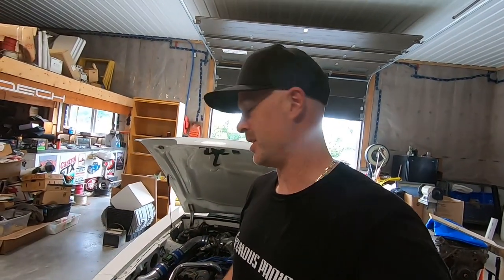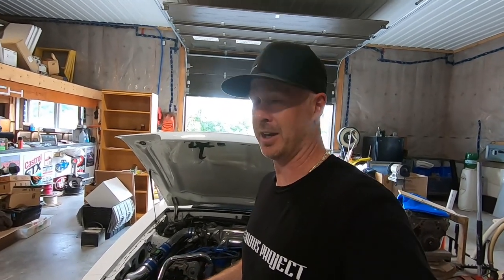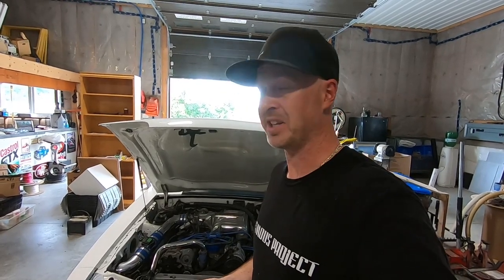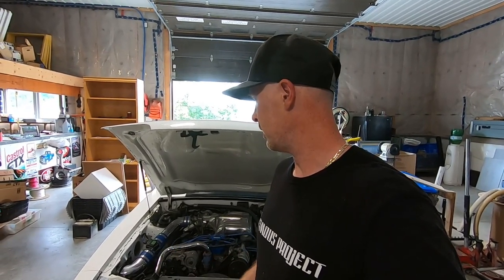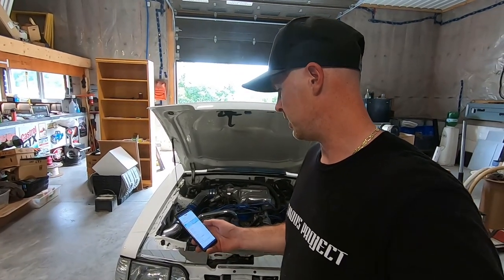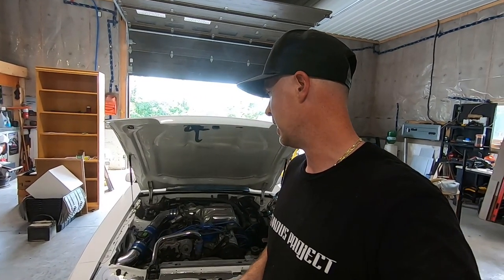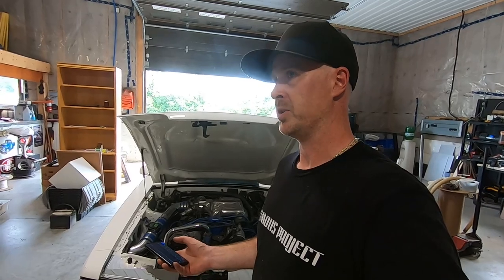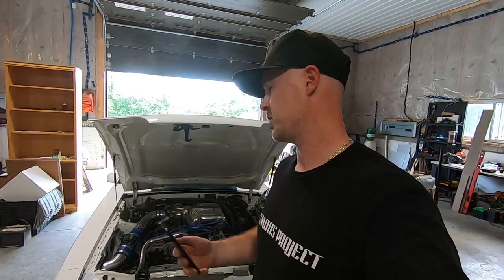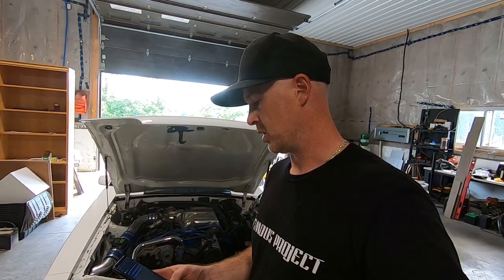That's a little strange — I unplugged the original MAF, put a different one in and everything works, then put the old one back in and everything is still working. All I've really done is move things around. Maybe there was a bad connection, or maybe some water got in there. I'll double-check all the connectors and make sure everything looks good. I want to leave the one that was tuned to the car installed, but we'll keep our eye on it — if my idle keeps surging, that would probably explain a lot if the MAF wasn't being recognized, since the computer would be trying to compensate for not knowing airflow.